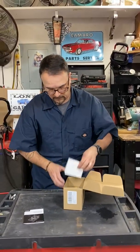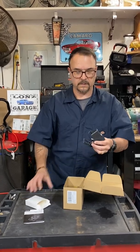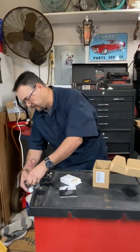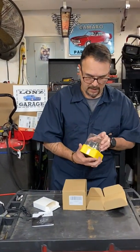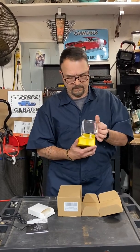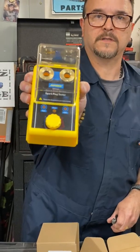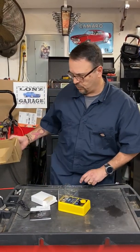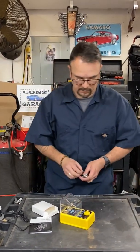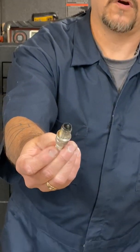I'm assuming this is a power supply since it does take power. I'm going to plug that in here, and this is the tester itself. So what we're going to do is test with a known good and a known bad spark plug. This is a fouled spark plug out of my old carbureted '69.